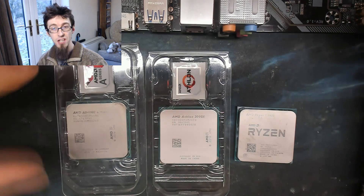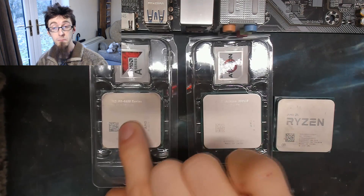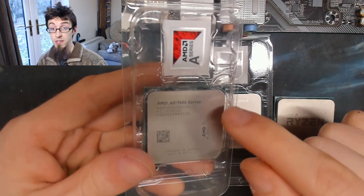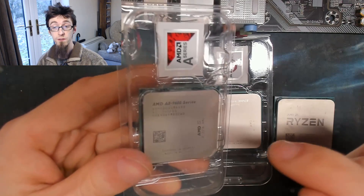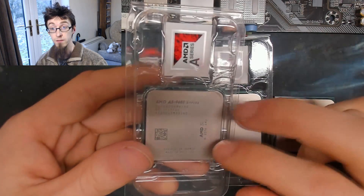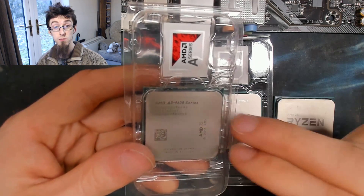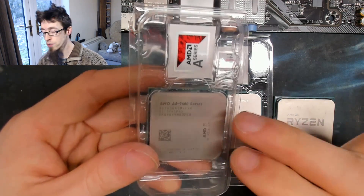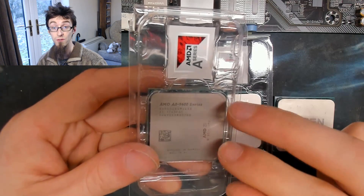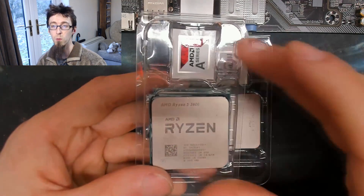And that's the catch, because Excavator chips like my A8 are dropped at F30, meaning there's a valley of death where the board appears to be bricked. Ironically, when Gigabyte served me a broken BIOS download that wasn't the version I intended, they actually saved me — because had I actually flashed F32 like I planned, I'd have ended up with an incompatible CPU and probably would have assumed the board was dead. I should have known this; I should have been checking the CPU support list. I just assumed the same old AM4 CPU I'd flashed dozens of boards with would be fine.